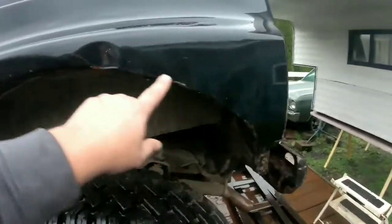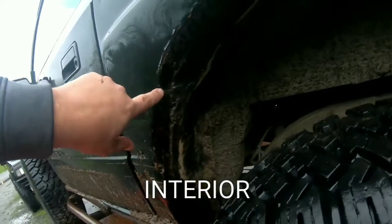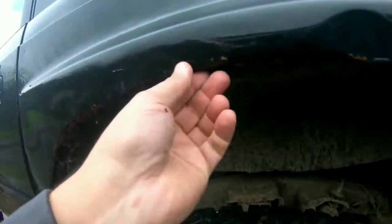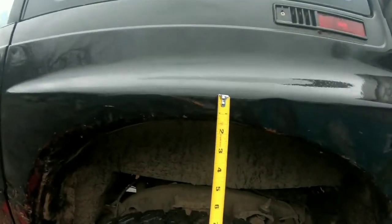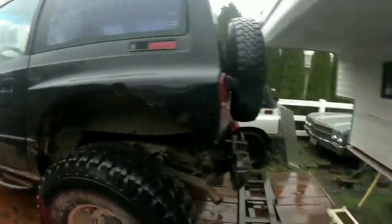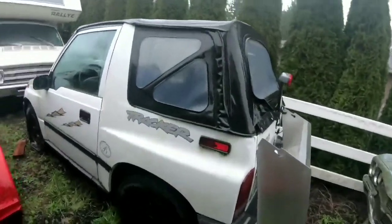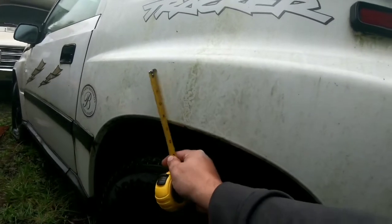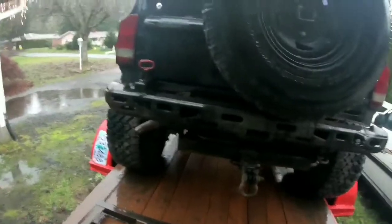As you can tell, the cut is huge. It got into the body a little bit, but what I did is I notched it and folded everything back so it made a lip, because on the inside that's where the wheel opening is. From that line we're looking at about an inch and a half or so. If we go over here and look at the stock Tracker, that line goes down actually four and a half inches — so that's how big that cut is. Roughly three inches worth of cut in order to get that thing in there, and now as it sits they do not rub.